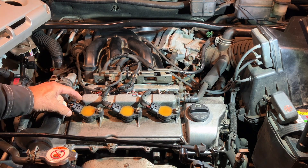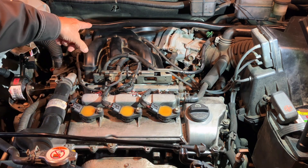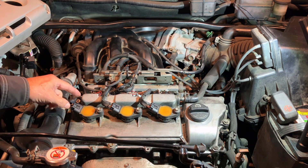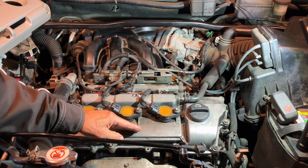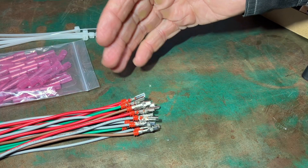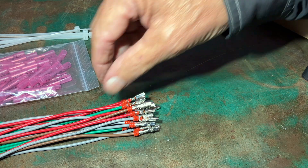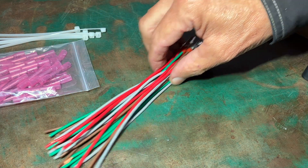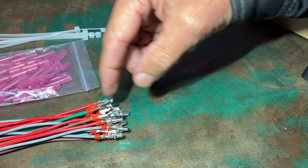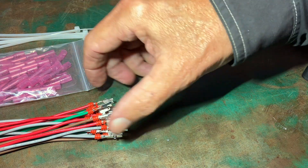The reason is because I recently replaced the connectors on the ignition coils on the front bank and the rear bank underneath the intake manifold, and the condition of the connectors — front bank versus rear bank — is huge. When I received the kit, these wires were plugged into the connectors that are now on my car, but rather than splice these wires into my existing wiring, I made the decision to pull these wires out of the new connectors and plug the existing wiring into the new connectors.